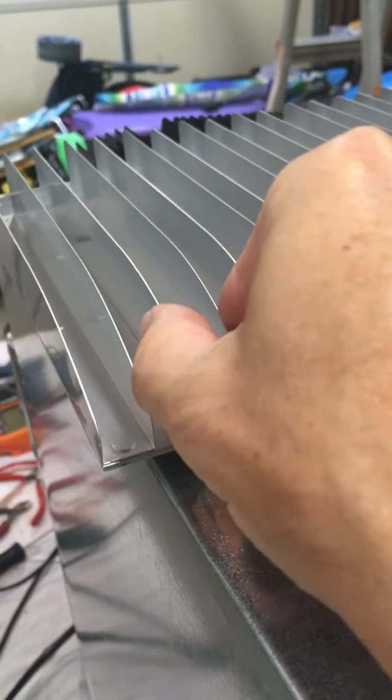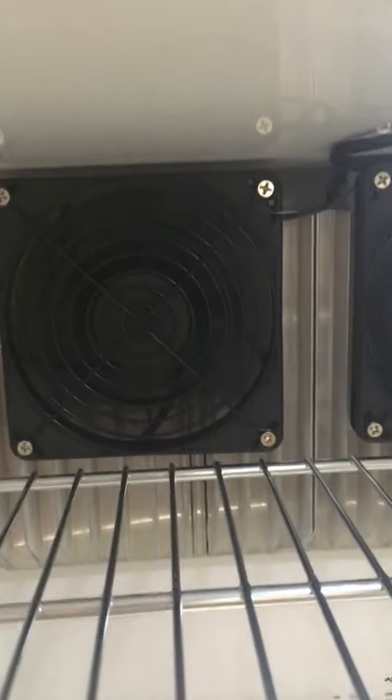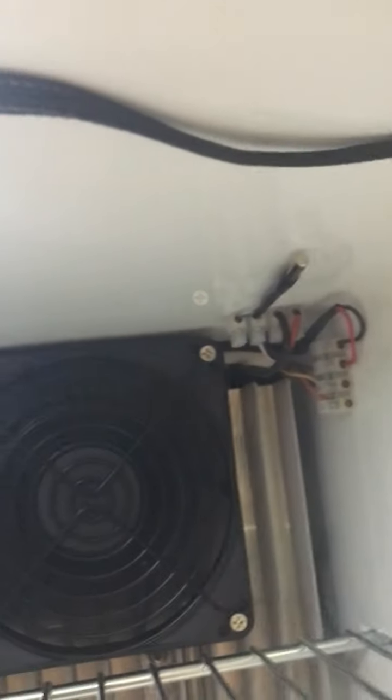Here's the fridge. This is the original heat sink with the bent riveted fins. Because I have modified this, I've got circulator fans inside and I've used the extruded aluminum heat sink. I've also got wiring coming in through the back.